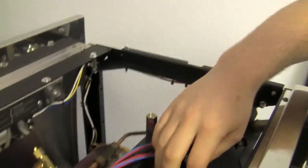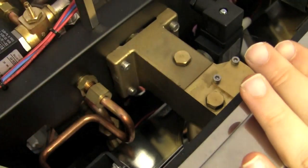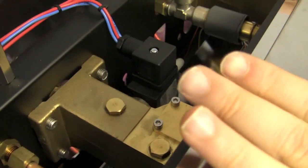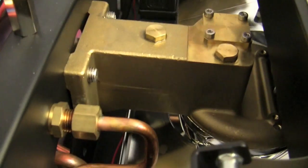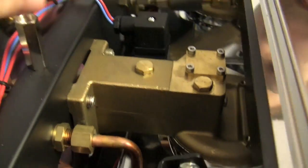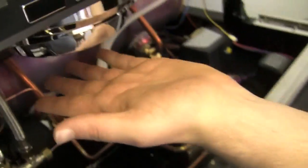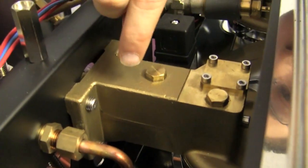Up to the front of the machine. We've got these gigantic blocks right here — these are group heads. Go ahead and touch it because we just turned it off. See how hot that is? This is one of the reasons it's a very stable machine — the circulation keeps this to 200 degrees. You're really only seeing a little bit of it on the outside. But as we go further in, that's where you're getting your temperature stability. We're trying to encase a little tiny tube of water and keep it as hot as possible — and keeping it at 200 is not overkill.